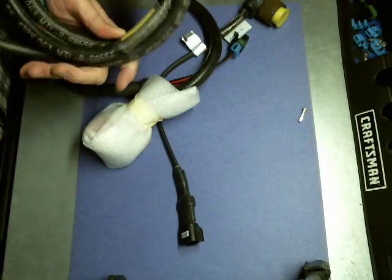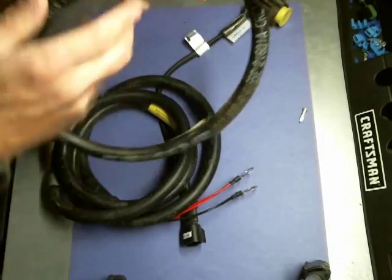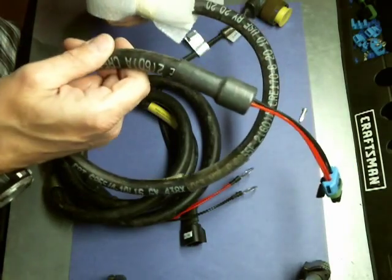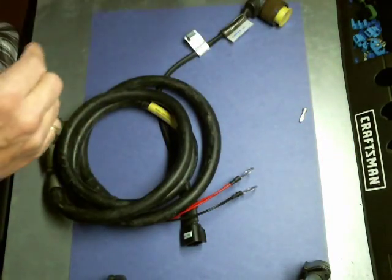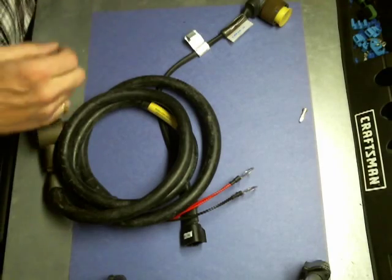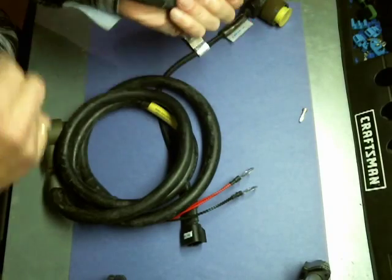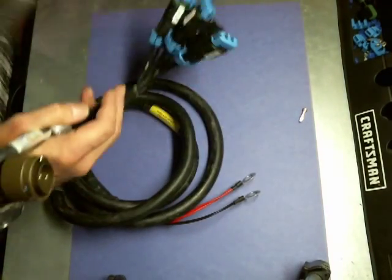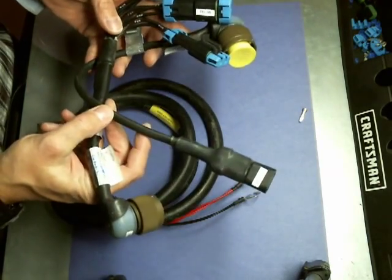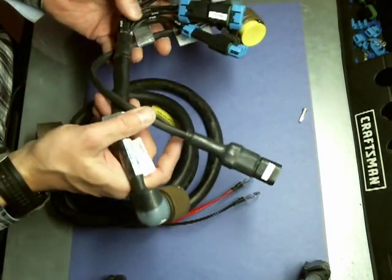This is a 6-foot — the same can be done with this one here, which I've already completed. It can also be done with a 3-foot power cable. Either the 3-foot or the 6-foot is required to interface with the SEER, the Medusa cable, or the single leg. Both of these are part of the Oshkosh trucks, and that's how auxiliary power is provided through CB7 and 8.